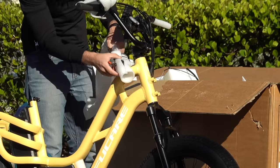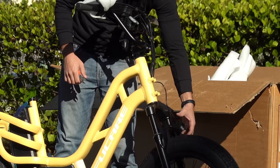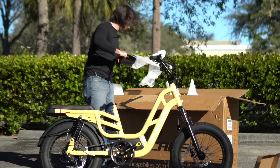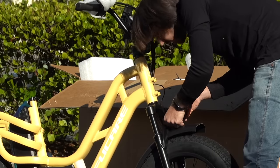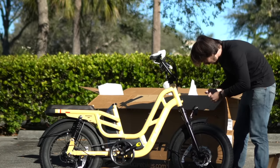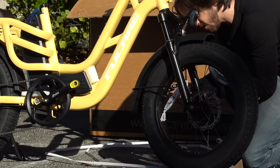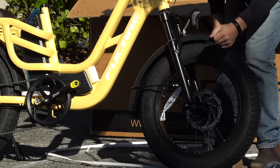Let's do a little more cable tie trimming and look at that pretty paint job. Here we have the front light. You generally want to wait to put that on until you've got the fender ready. The fender is back here — it's least likely to get damaged back there. Let's slip the fender right in and set up the headlight at the same time. Get that finger tight and then finish it off with an Allen key. I usually try to lift the fender up as high as it'll go within its adjustment range, making sure nothing's rubbing on the fender stays.